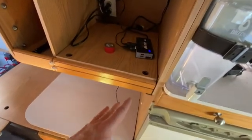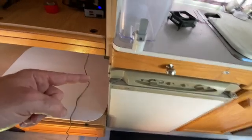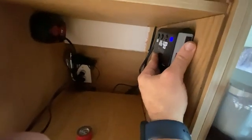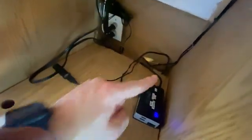Now that we know this is going to fit and work, we've got to work on the wiring. When it comes to powering these fans, there are many ways. Some people will have lights in their RV fridge and can hook it up to the power right before the switch for the light. But if you don't, you can get your power from this car adapter. You can slide this drawer out and there's an access hole in the bottom, then feed that wire through, bringing it around over and down. Let's get this little power distribution center mounted to the wall.